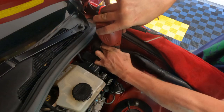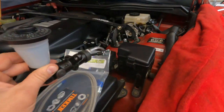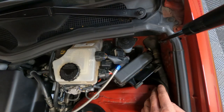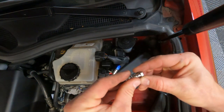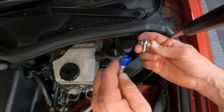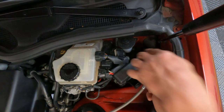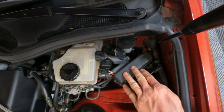Due to limited space, it's best to get this line hooked up while the master cylinder is off, then bring it into place and coil and stow the line until you're ready to get the rest of your swap done. You want this that comes nicely vacuum sealed in the XAT Racing parts kit — this is a bolt. You're going to put the provided washer on that bolt, then take the eye bolt, put that on, and then the washer. I recommend tightening your fitting onto this assembly so you can put this T onto the clutch master cylinder with this engaged and torque it down — that way you don't have to try to do that afterwards.